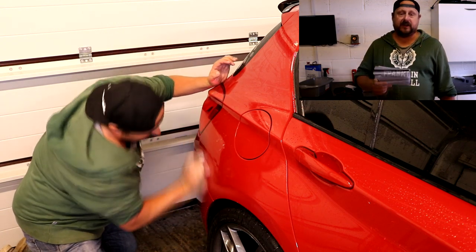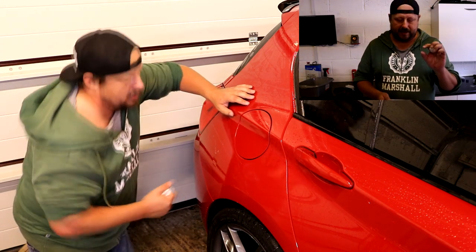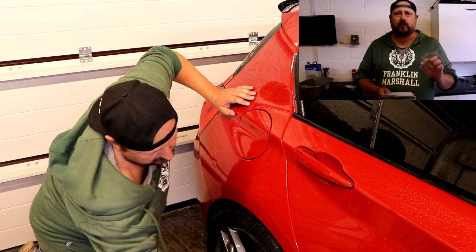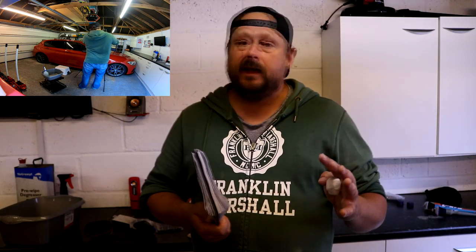Do you need to polish your car after claying? Yes, because claying scratches the surface. These are very fine surface scratches — don't panic. Not everyone needs to machine polish; you can get away without it. Many professional detailers will do a quick clay as part of a detail and then go over the car with a hand polish or wax to fill some of those fine surface scratches. From a detailing principle, you should ideally polish after claying, but there's no strict right or wrong.